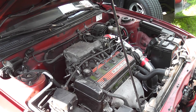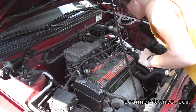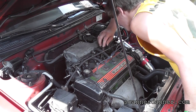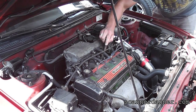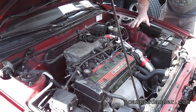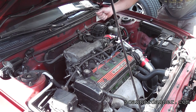What we want to do is right down between here, Jake, I want you to eyeball this. Let me see the tire iron, I'll point to it. This is your starter housing right there. That's your starter motor. What you want to do is you're going to do this about this hard, while I go inside and hold the key in the crank position. So if you were ever stranded and you run into a situation like this, you could totally look like a hero if you have your friend go in and hold it in the crank position, and then you do this.